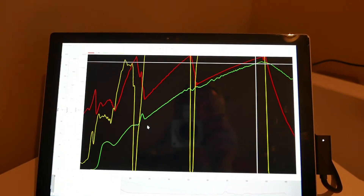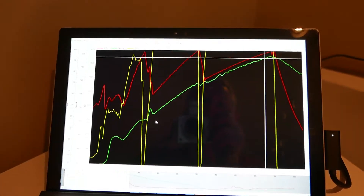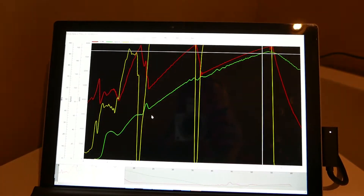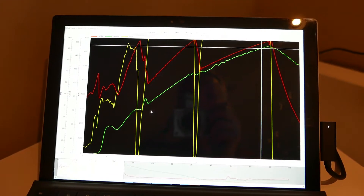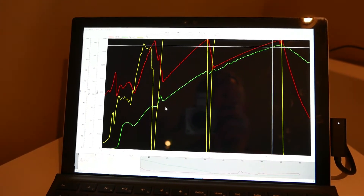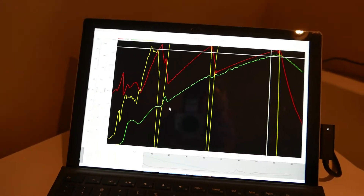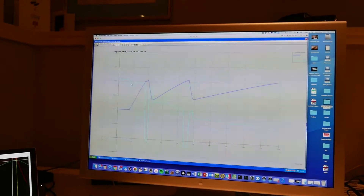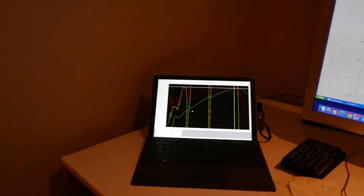About 0.2 seconds after I clicked the last timing light I was doing 111 miles an hour. At 8,000 RPM in third gear it's 111 mph, so I'm crossing the lights just before that point. In a quarter mile, they measure an average of the speed 66 feet before the end of the quarter, and I'm hitting 8,000 RPM around 30 feet after the last timing light. If you single-frame the video at 60 frames per second you can watch the RPM on the digital dash through the timing lights at 1/60th-of-a-second increments. With the 204 wheel horsepower the dyno showed, it should theoretically translate into a low-to-mid 12-second, 110-plus mph quarter mile — being at 13.8 and 104-105 is understandable given the circumstances.